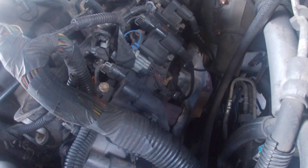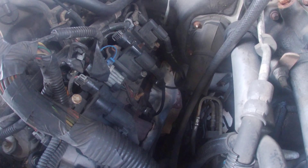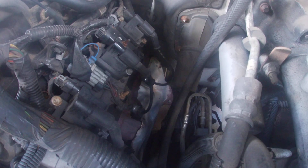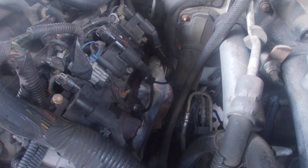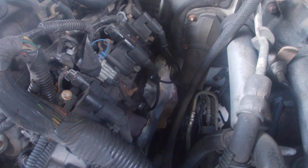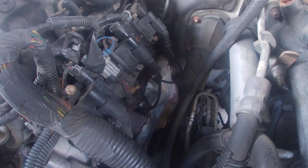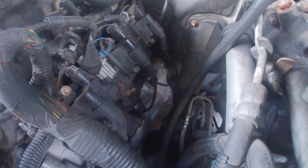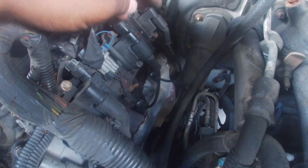So if you're just going to do spark plugs and then reuse the coil plug, you may get a misfire and you won't understand why. You'll think: oh, maybe I didn't get the right plugs, maybe I have an intake manifold gasket leak, maybe the coil is going bad.